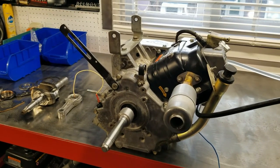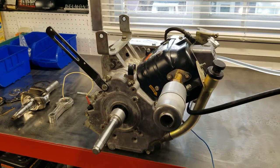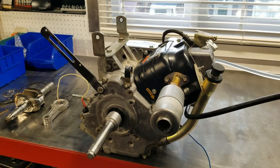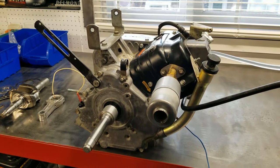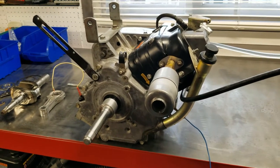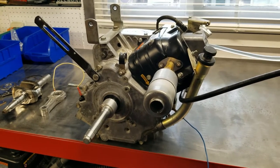Guys have called me many times saying they noticed clearance between the check ball and the spring. In theory, pressure results from a restriction to flow, and a relief valve should only check the ball when the set pressure is reached. But in our case we have some bypass flow, and that bypass helps prime an FE series oil pump.